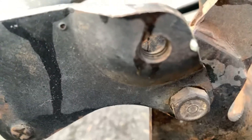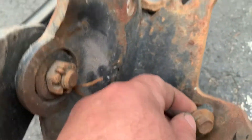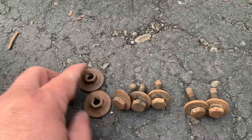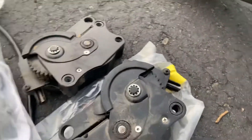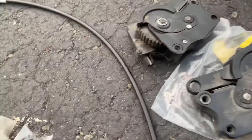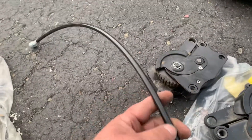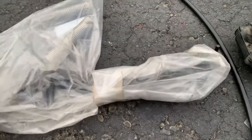This doesn't look like an original one — that looks like an original Chevy one for an engine, but it's too long. This is the crack I was talking about. I have six bolts that go there for that plate, and some mount hardware for the rack — I'm missing one here. The gentleman already got the gearboxes redone, though these are a little pricey. New latches — we got a pair of those. New alignment pins. Tension cable for when the top goes on. We got one of the drive cables, so we're going to need the blue one. These arms are brand new also; we got the tension springs and the arms for the glass back window. I don't see the end links though.